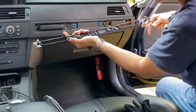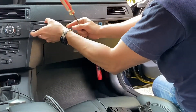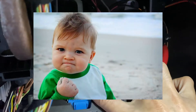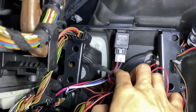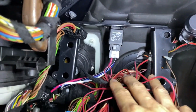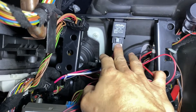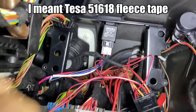Now it's time to access the wire on terminal 15. It is in the back of the fuse box. The walkthrough of fuse box removal is also in episode 2. Be prepared for the tough work. I think I will hide three relays at the back of the fuse box. It may be a little squeezy, but I'm going to protect the relays with anti-vibration tape.